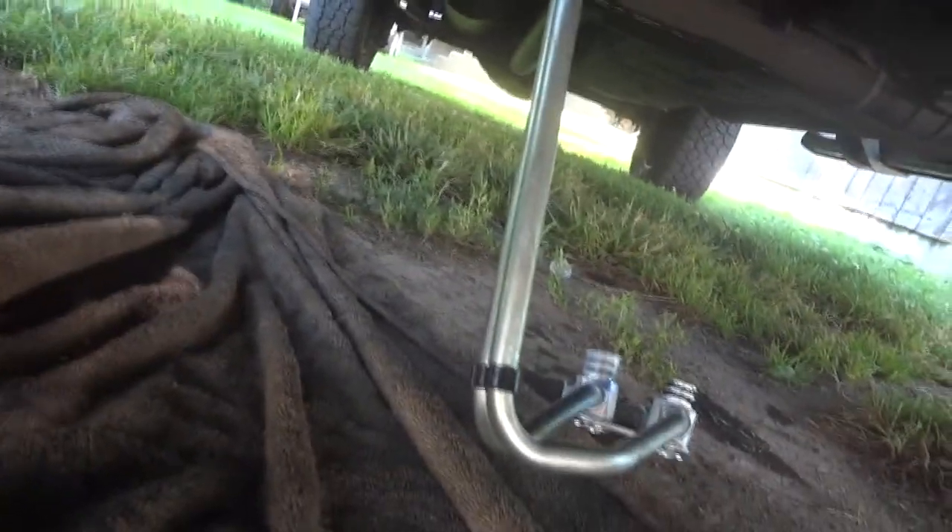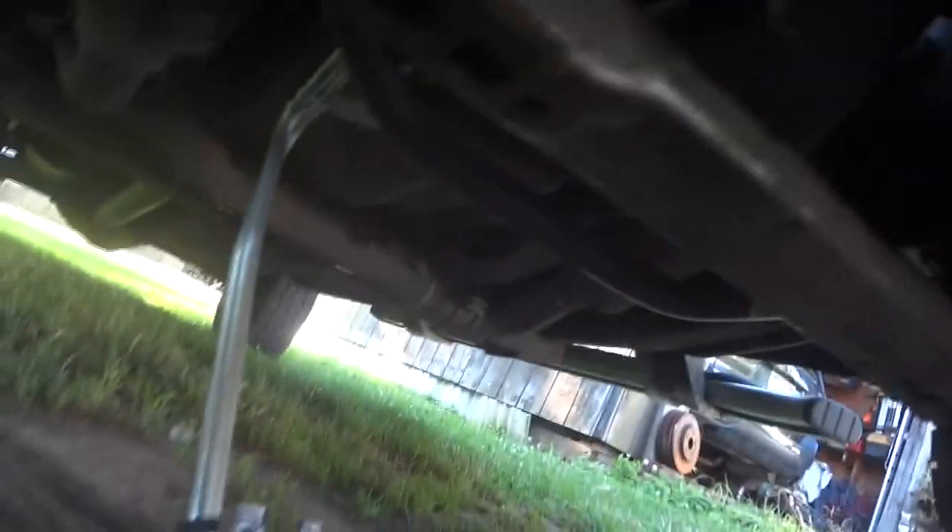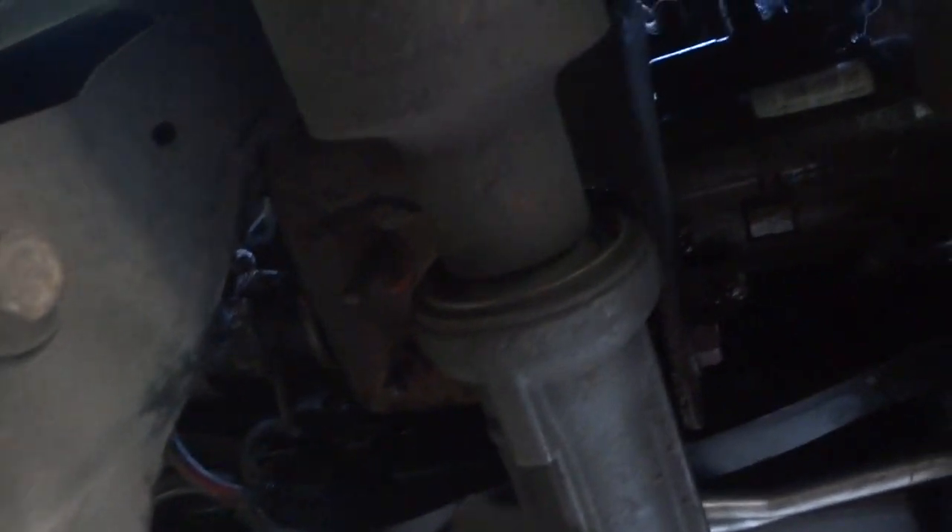All I've got to do now is go back and bolt this on the side of the transmission, get it tight, mock everything up, and I did go ahead and take out the old bracket bolt — I'm just going to use my new one. I did have a brainstorm: one thing you can do if you're having trouble is take off these two motor mount bolts right here, then lift the engine up on this one side a couple of inches with a jack under the oil pan and a block of wood. That would probably give you enough room and make the job a lot easier. But you can still do what I did — with some choice words off camera — and it's in.